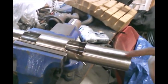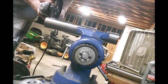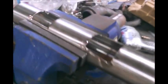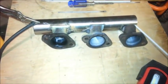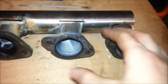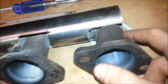Time for number three. Got the car sitting all crooked, getting ready to be welded. Time to get some tack welds in. I was able to pull it out with a little wiggling, but there are some gaps from trying to fit it in right. If you see big blobs of welds, that's from me putting little pieces of metal over the gaps and welding over them to seal it up — like band-aids.